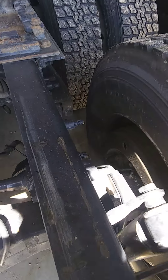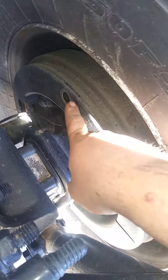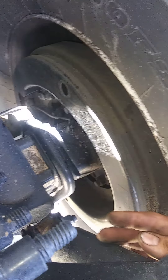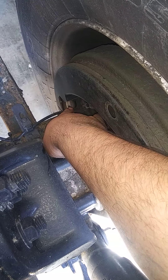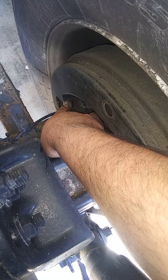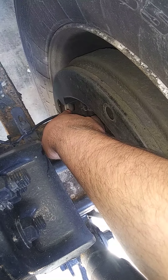Check your airbags again. You can sometimes look up through the bottom — though dust covers may block your view — and check your wheel seals. From right here I can see that drum looks very bad, so obviously it's going to need drums and brakes. If the drum looks like that, the brakes surely will too. Everything works together.